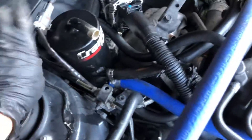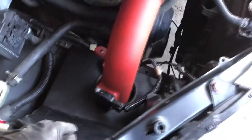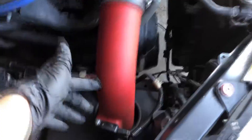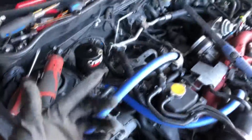The air oil separator is mounted and all the hoses are connected. I also have the AEM intake installed — I had to pop the side fender liner just to get the cone inside because the heat shield was being difficult. Put this in first, then route it through, then the cone at the bottom. Next, put the intercooler back on and hook everything back up.